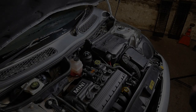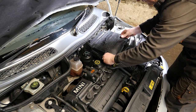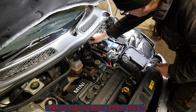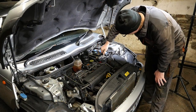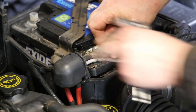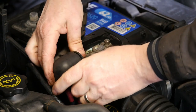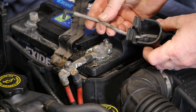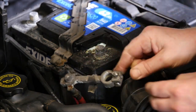I'm going to remove the battery and tray for better access — you may not need to do this. Pull the weather sealing off and take the top off the battery. Using a 10mm socket, remove the negative terminal first to prevent shorting anything out, then the positive — also 10mm. Lift that clear; there's a little piece of rubber protection and a small vent pipe in the battery area.